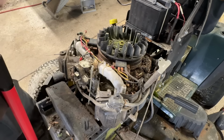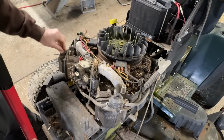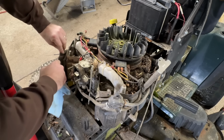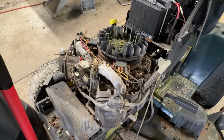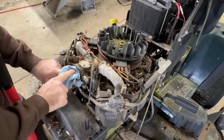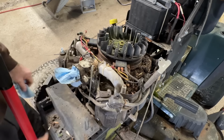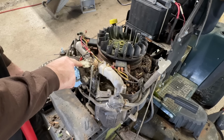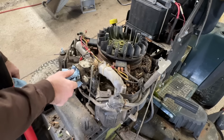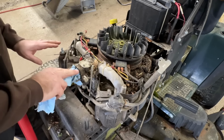It'll be fine. So I'm going to seal up a few holes in the motor so I don't get debris down them. Breather grommet here. Just some rags of some sort. And seal this carburetor up, which is going to have to come off to be cleaned or replaced. The kit for this is more money than an aftermarket carb, and the aftermarket Kohler carbs do work good. Some don't, but the Kohler ones seem to work good. Okay, that's sealed.